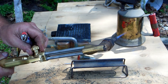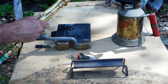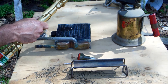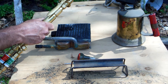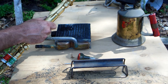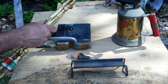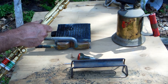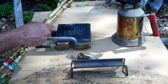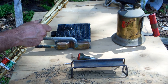I know you're tempted to take this torch and just put it on there and heat up the radiator, but don't do it. I've done it and trust me, you don't want the results. I've learned the hard way. I can do one with a torch — or at least I have done one in the past — but you've got to fill them up with water, put them in a water bath. This is a slower process, but not when you ruin one and have to start all over.